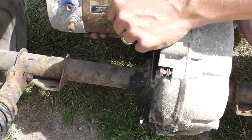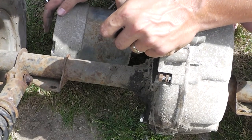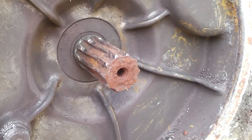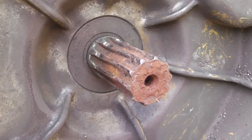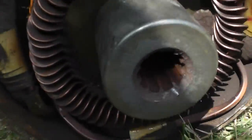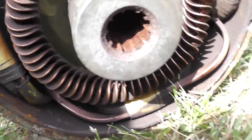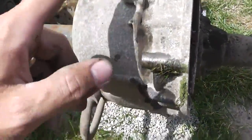That's heavy! There's the problem right there — that shaft that goes into the electric motor is all stripped and rusted up. Same goes for that side — there's not much left in terms of teeth, so she's just grinding away.